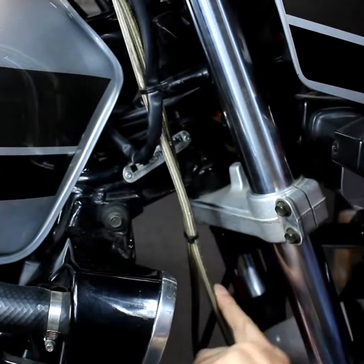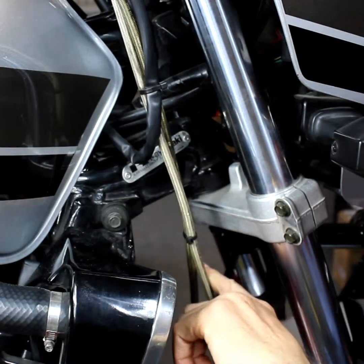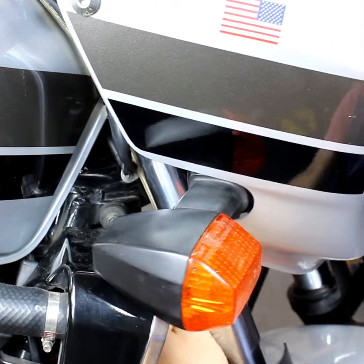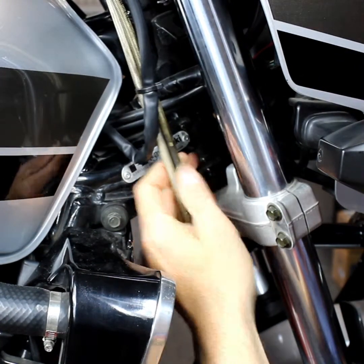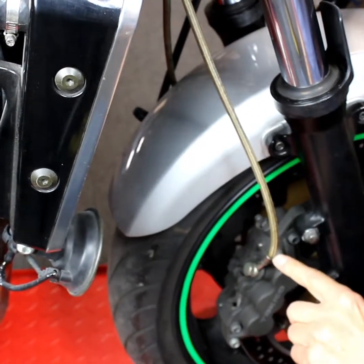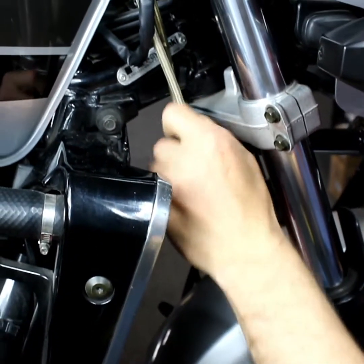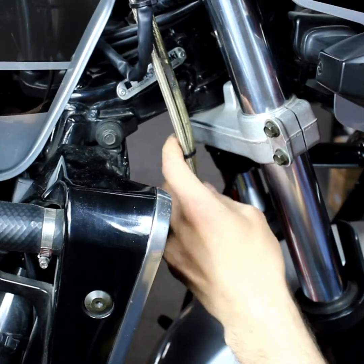However, with this bike, what we see is that whoever put these brake lines on hasn't routed them correctly, and they're getting trapped here on the chassis and on the fork leg. They're actually getting pinched, and you can see there are kinks, there's wear, and they're also pulling the lever. I'm not even sure they're the right length, which means they're going to start putting tension on the joints here, which may cause problems. So these need to be replaced. This isn't correct. Again, this is an important thing that we've picked up on, and I'll do this immediately.